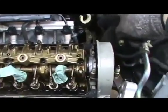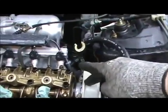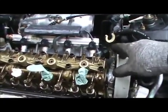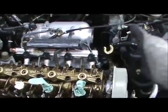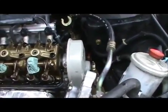Now I can take this cover off. You have to take off the valve cover because this lip right here sits over here, so you can't just take this off. I took off the valve cover and I'm going to put it somewhere nice where it's not going to get dirty. Then we're going to come over here, take the 10mm head bolts off the upper cover, go down below and take off the lower cover, and then we can access the timing belt from there.